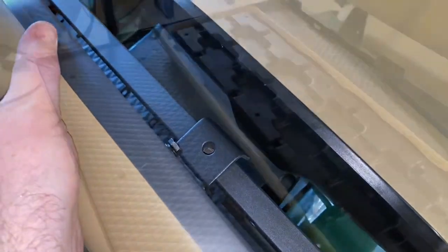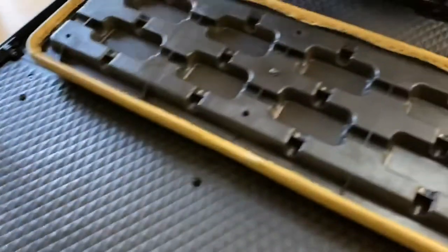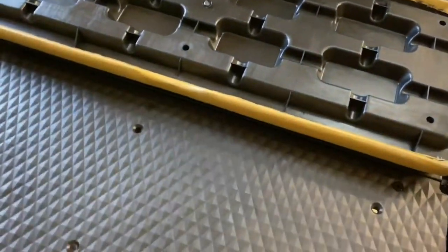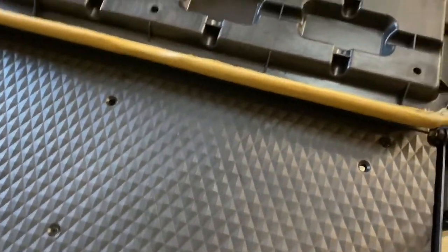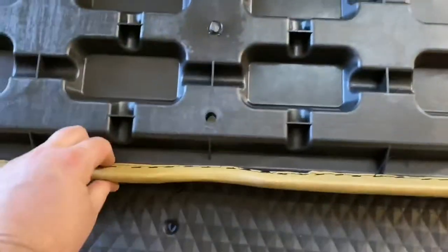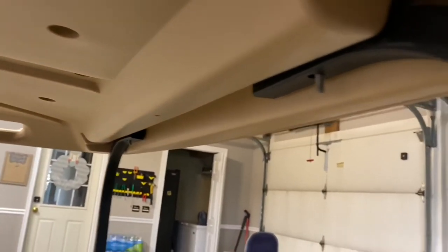The next step is taking the six little screws and holding the seat up against it to get them screwed in through the holes. Make sure you have the part with the little notch on this side so that when it's folded up, you can pull it out. Then use those two holes to line up with these two, put this piece on, use the supplied bolts, and then put the roof back on — reattaching it using the hardware that already came with your golf cart. And we're about finished.